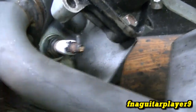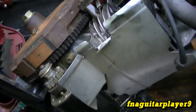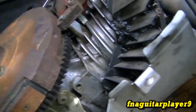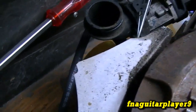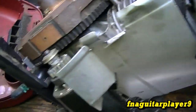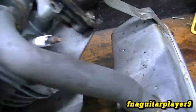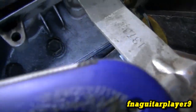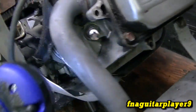I just tried to pull that off and it broke. The motor turns over, the piston is moving, and the valves are moving — so there's no major internal damage as far as all that goes. But I'm concerned about the cylinder being scored before it got so hot. One thing helping this motor is it has an oil filter and oil pump, which probably saved it because even if there wasn't much oil, there was probably still enough for it to pick up. But looking down here I can see a burnt spot — I think it got so hot that the head gasket blew.